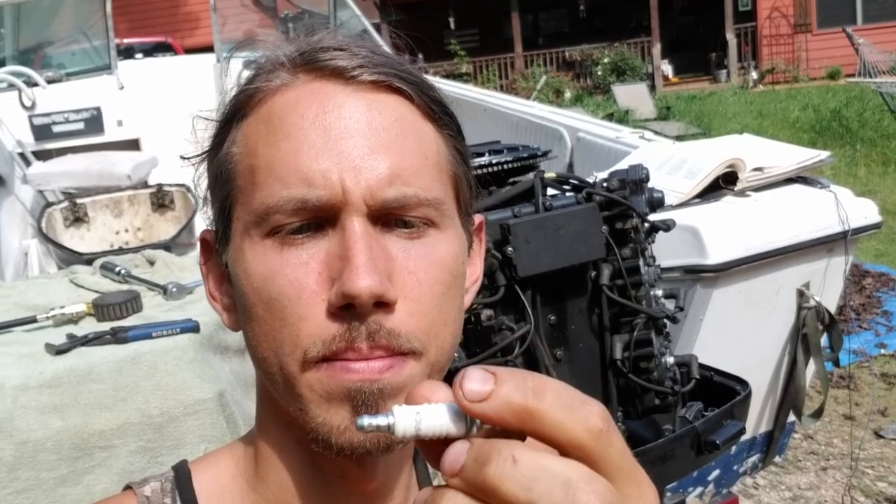We put these in there — the QL77JC4. I think it was actually the L77JC4, a different plug but pretty much the same thing. And it fixed it instantly. Now, you can only get away with doing this trick on certain Evinrudes. I don't think it works on other outboards. Basically, if it has a permagap plug, you can replace it with a regular J-plug, but you have to look it up. If you just try to do it, the piston will hit it and it'll mess stuff up.